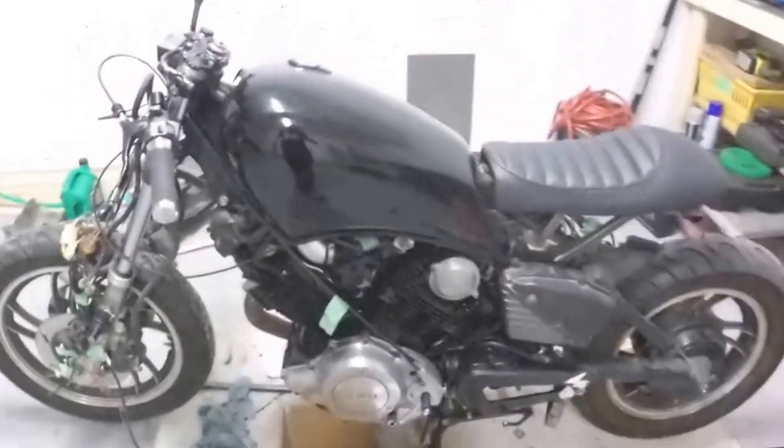So I just grabbed a grinder, took out the set screws, ground the thickness of the blade down, and put the set screws back in, and that got rid of some of the material to be able to make it nice and solid. Had to do that on both sides, as you can see. Now it works, it's pretty solid, so we're making progress.